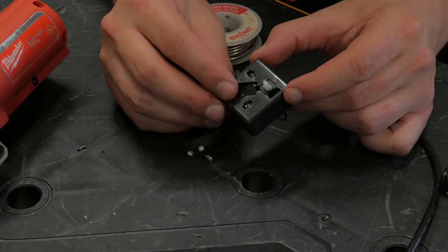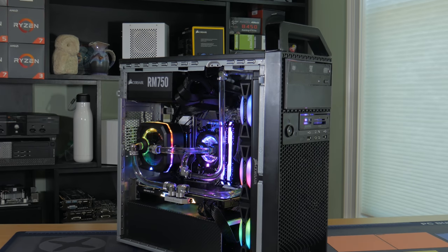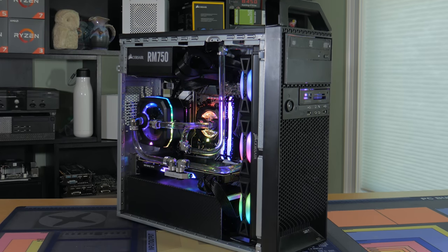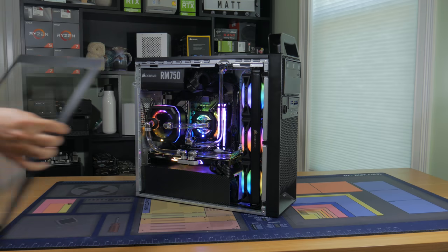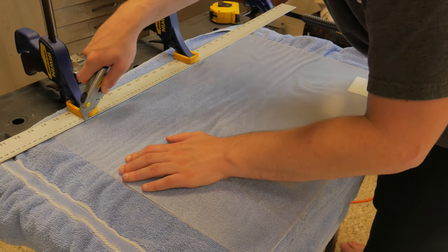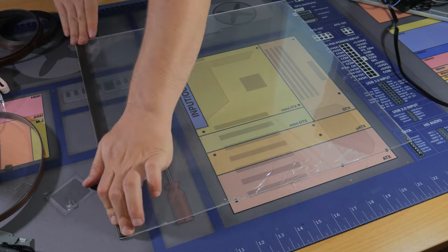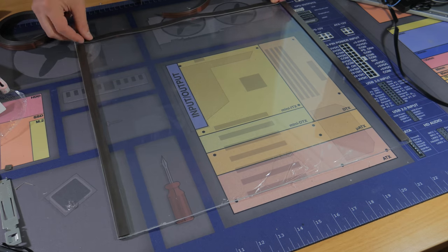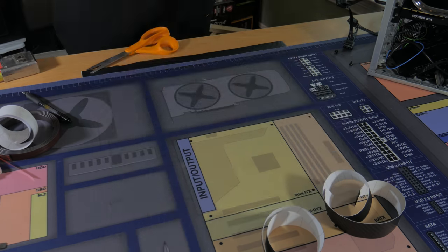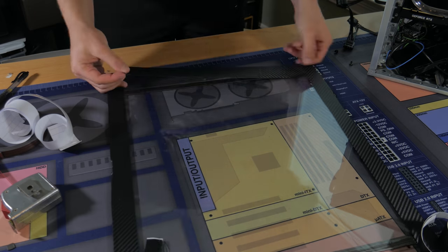With this done, I took a step back and was seriously happy with how the system was turning out, but was disappointed I would never be able to see the internals. I wanted the original panel to work for full stealth mode, but I also wanted a window for when I wanted to see the loop and all the pretty RGB LEDs. So I made my own DIY magnetic side panel. I took a sheet of clear acrylic, scored it on two edges and snapped the excess off to be left with the size I needed. To mount it I used magnet tape — I cut down strips and applied it to the edges of the panel. I then used the same vinyl from the cable shroud, cut into just over one inch strips, measured one inch on the acrylic and applied each strip to make a good looking border, then flipped it over and cut off the excess vinyl.